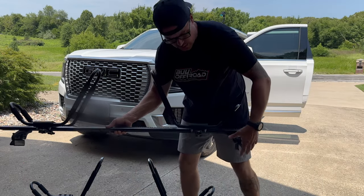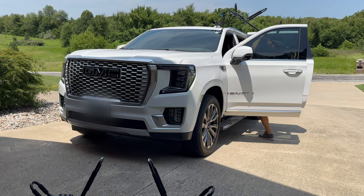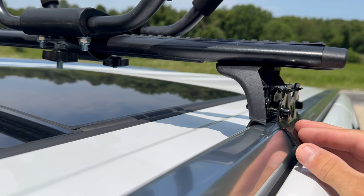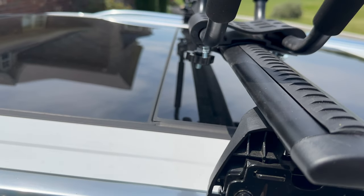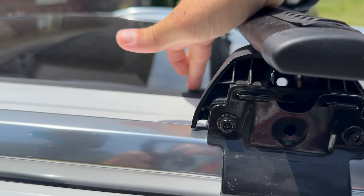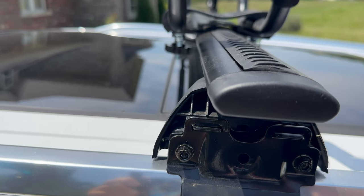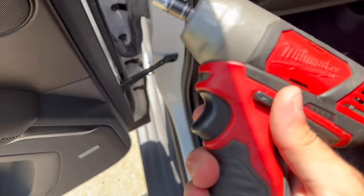They do move here, so it makes installation super easy. I really like that these clamps have a nice thick rubber coating on them to help protect the chrome coating on this roof rail. To make sure they are lined up, I like to find a guide point — I'm going to use this crack in the sunroof and just make sure it's lined up perfectly with the glass. That will be my line location for the other side as well, ensuring they go on perfectly straight.